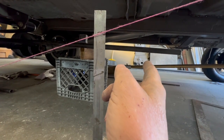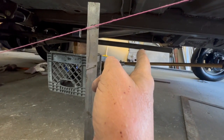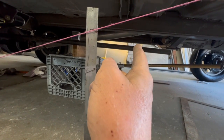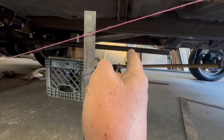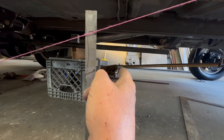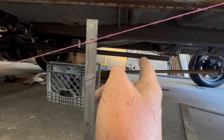I'm not sure exactly what I'm going to do. I'm going to probably finish the mount itself, get it up underneath here, and see what kind of length I have for the shackle. I don't want it too short. If I have to, I might mount the shackle in the frame rail, which will require a tricky shackle. But we'll figure out where we're at. So right now — take this off, measure it, cut it, put it together, get it back underneath here, and figure out what I'm going to do on the upper mount.